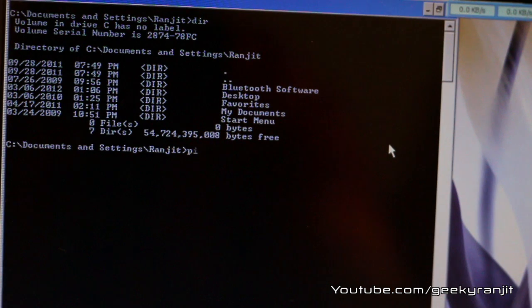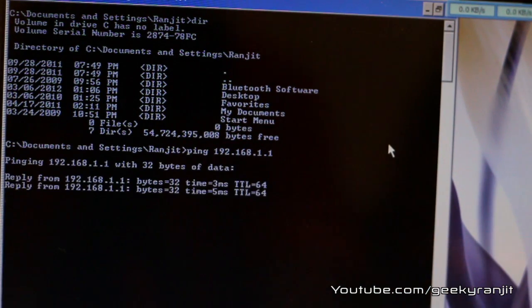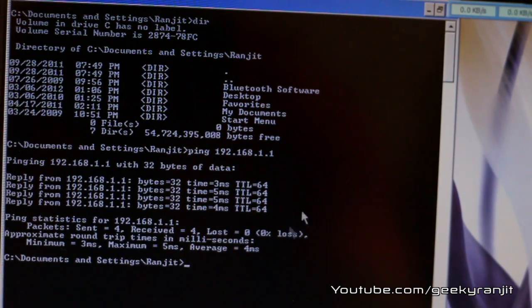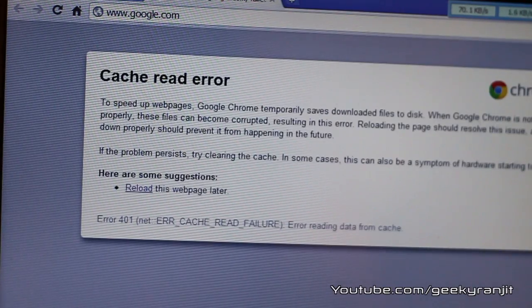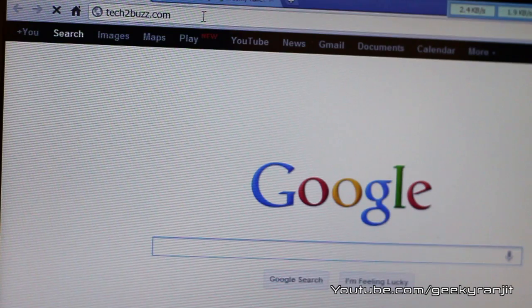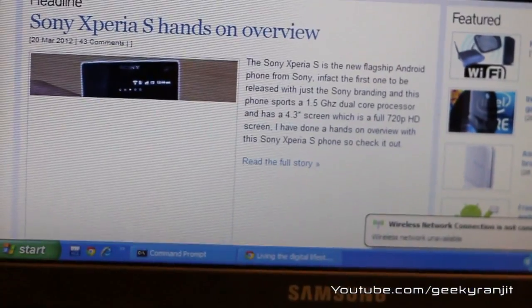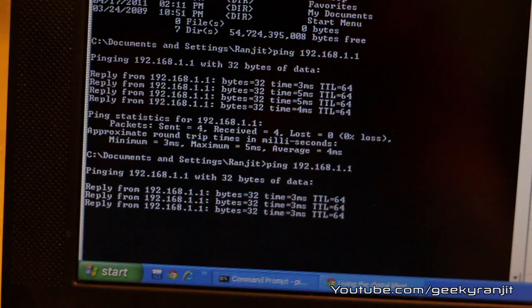I have connected another Ethernet cable and now we're going to test it with a laptop. Now I'm connected to my Powerline Ethernet. The first thing we're going to do is ping to the router — I want to show you how effective this Powerline Ethernet is, as it lowers your ping. As you can see, we are getting a ping rate of about 3 milliseconds. In my testing, the lowest throughput I got was 24 Mbps and the highest was 45 Mbps. I streamed a lot of HD content and everything worked without any issues. We can see the tech2bus.com website loading fine, and we're getting a consistent ping of about 3 to 4 milliseconds.